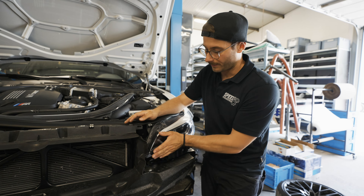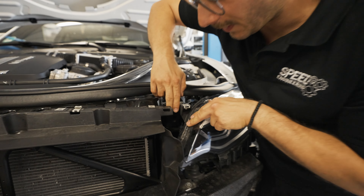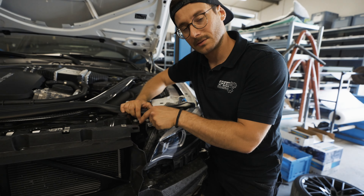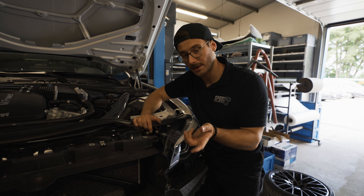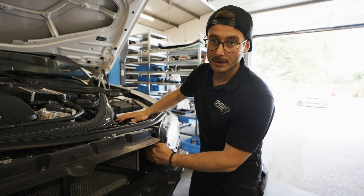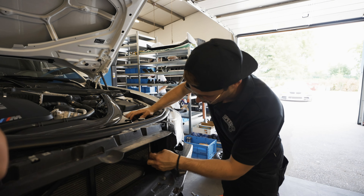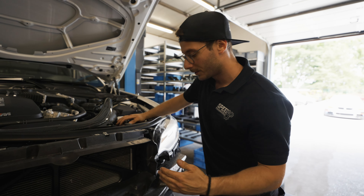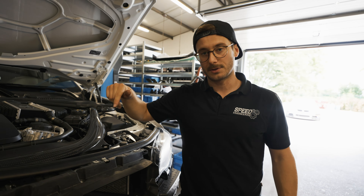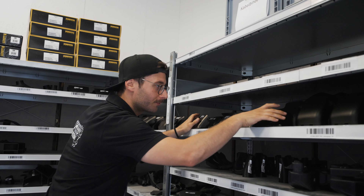So this is what I mean. Imagine the bumper is closing everything up here. We have the headlight and behind the headlight you can see the intake — this is the intake of the airbox. It's hidden quite far away from where we could get some air. We have fresh air here and a barrier in between — this is our place to attach our ram air kit to redirect fresh air to the airbox and to the engine.